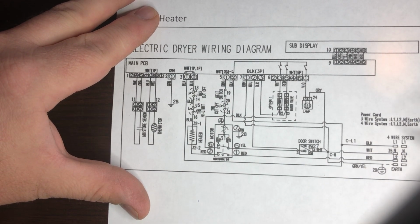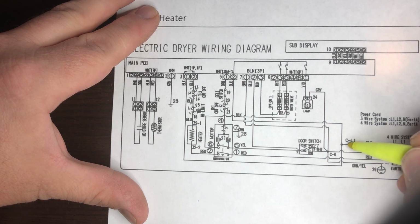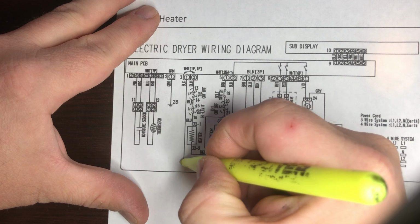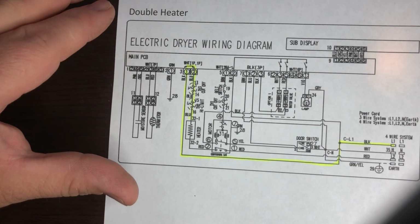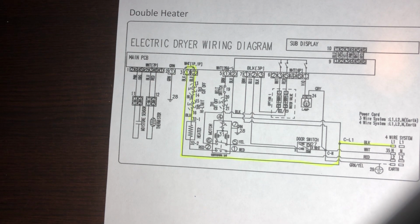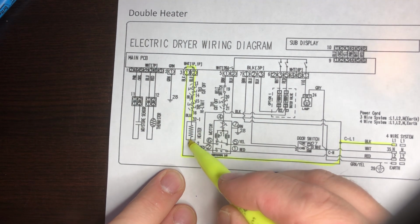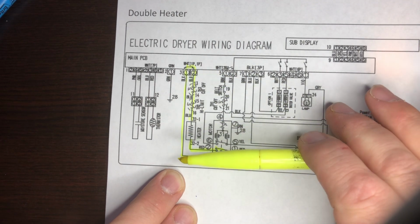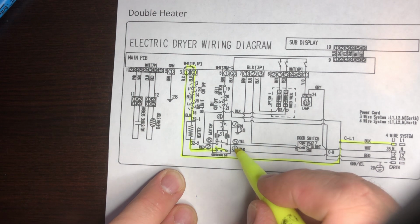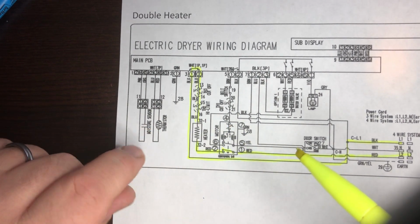So how the heck does that work? I don't know. So you have the heat relay. Oh, L1 goes to the heat relay, right in there, through the heater, that heat relay. So Samsung has a weird thing where they will not close this heat relay, which continues on this side through the motor centrifugal switch. Remember, the motor turns on, goes click, and it closes that part of the circuit when the motor is running. It goes over here to line 2. So to turn that heater on, you need centrifugal.